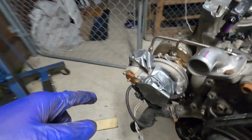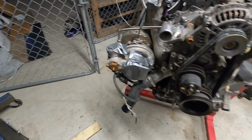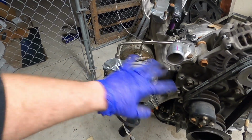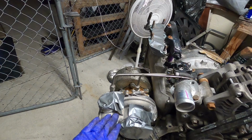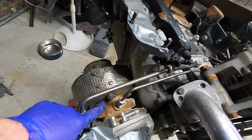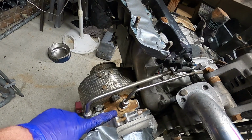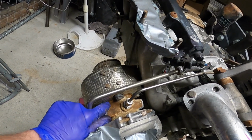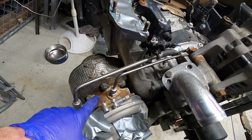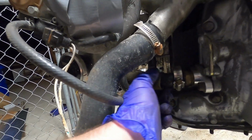Oh yeah, the turbo. Obviously the turbo looks fine. We covered it up while we were grinding in the engine bay, working on the V-mount intercooler setup, but we are going to pull the front of this off, blow it all out with air, and I'm going to clean this up and get it looking nice again. While I'm doing that, I might clean up the center section, just because, you know, this isn't fire related, but this is just from heat cycling the cast iron, which I believe this is, or steel. And we'll replace all the hoses just in case anything happened down here.